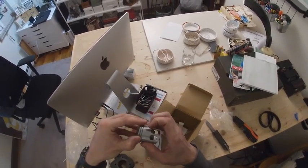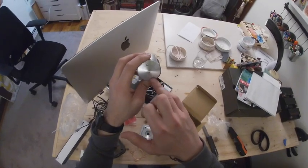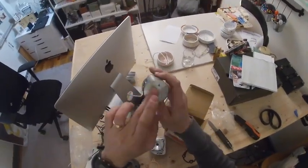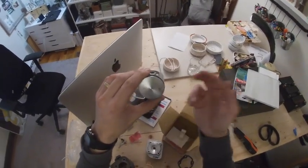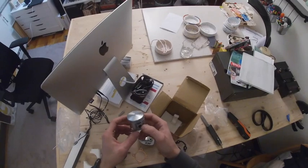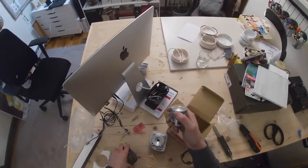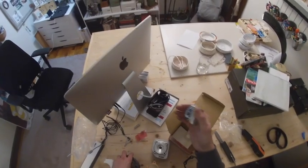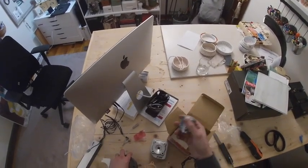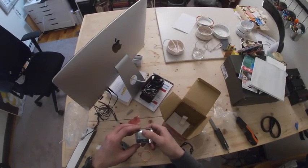The last thing to check — there's a 'G' embossed on the piston, that's for 'good.' It's a good piston. Depending on where you are — up here in New England doing a 70cc kit with no exhaust mods and a stock airbox — you're probably looking at about an 85 main jet. The Buddy 50 comes stock I believe with a 75, so an 85 should be just fine. We'll do a couple plug chops and should be good. We'll try it in the morning.